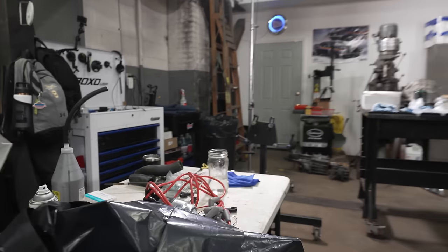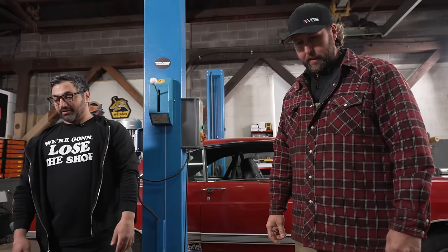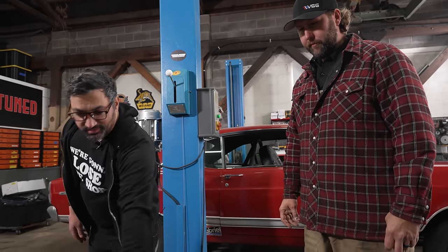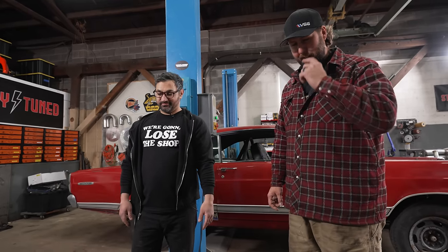Anyway, I came back through and sealed the heads up right. I checked the piston to valve clearance. It's close, but it's workable. These have the factory valve relief, so I think that helped us a little bit. We could just float it in the parking lot, and if it's going to break, it'll break right here. It's going to be good. So we went back and dialed it all in last night. There were these ribbed street rod valve covers, so we milled them down and painted them up. Wow. Ready to rock. Well, thanks, guys. Yeah, dude.